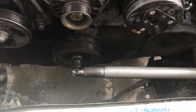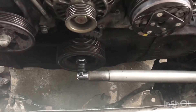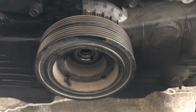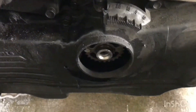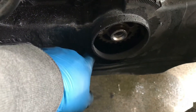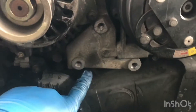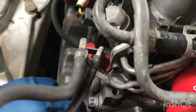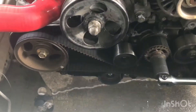Now take out the bolt for the crank pulley — crank the engine just enough to loosen the bolt. Once the bolt is out, take the crank pulley off. With the pulley off, you can see the timing belt cover is slightly damaged here, but there are an assortment of bolts all over the cover — go ahead and take those out.